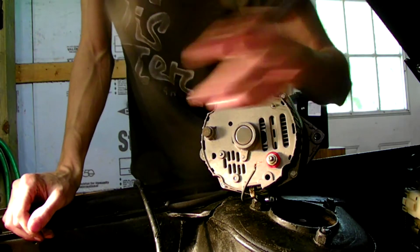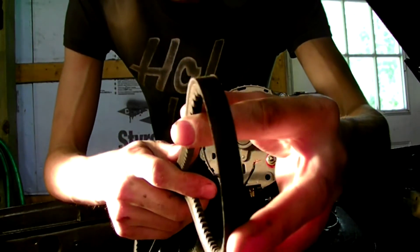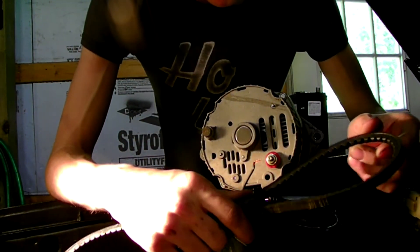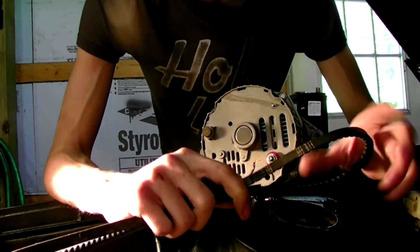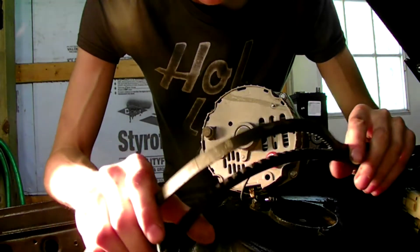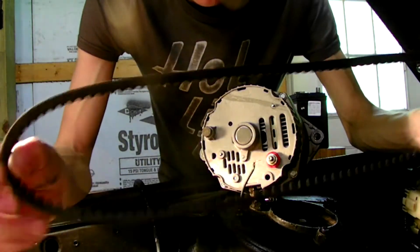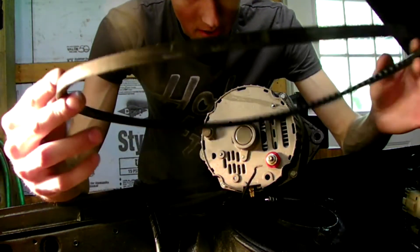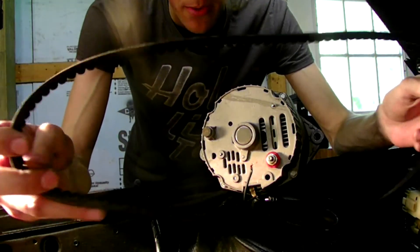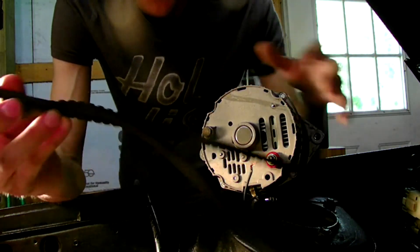One more thing I want to mention: this is the belt that came on the car. As you can see it's a pretty thin belt. V-belts generally, even if they're thin, are still going to work — it all depends on how much resistance it's going against. Eventually I'm going to want to put on a thicker belt, but this is the same exact width because you're using the factory mounting point, so you do not need a longer belt. This is still going to be a fully adjustable system, even with this large alternator.